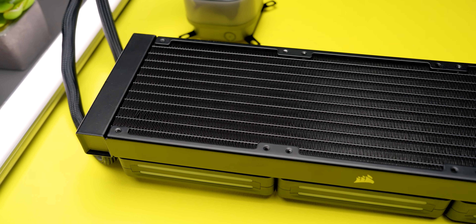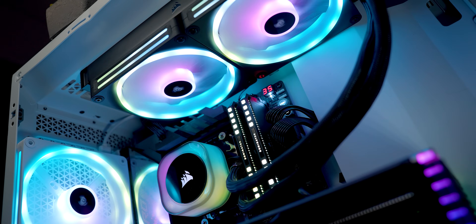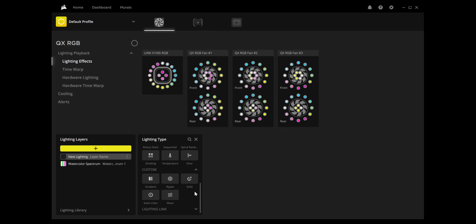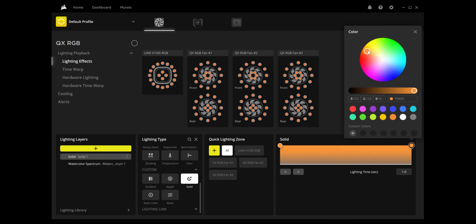From an AIO perspective, Link is all about more control and more data. You get pump and fan speeds, plus a coolant temperature readout from a sensor embedded within the loop, and a quasi ambient temperature from probes on each fan's outlet. For some folks it might be information overload, but personally I love more data. The radiator has been lifted directly from Corsair's high-end Elite series, though the pump received a complete makeover with better flow rates and lower noise. There's also fine-grained control for individual fans since each one gets an onboard MCU, down to the individual LEDs. And the biggest shock — through all our testing, iCUE did not crash once.